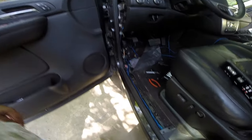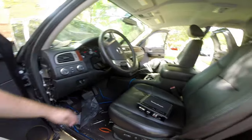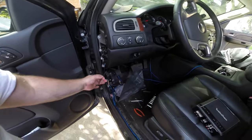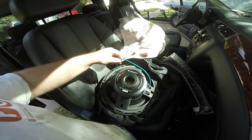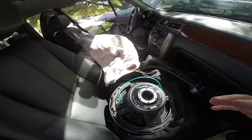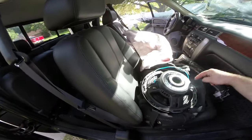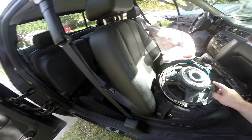Routing the speaker wires and the ignition wire back through the same channel. Until I install the head unit, the speaker wire is just going to have to chill — it'll run up the back of the dash to the new head unit. Now before we install the subwoofer, I'm connecting the positive of one voice coil to the negative of the other. This is a dual voice coil — dual 2 ohms — and I have a mono amplifier, so I need it to see 4 ohms. Two ohms plus two ohms in series gives you 4 ohms, and the positive and negative terminals from the amplifier come in right there.